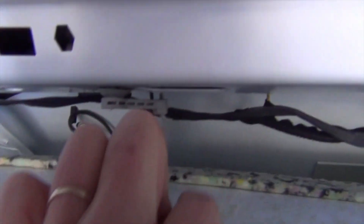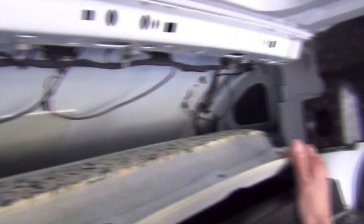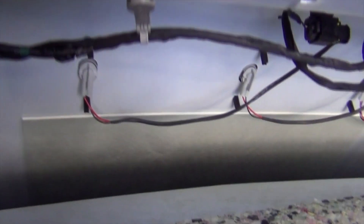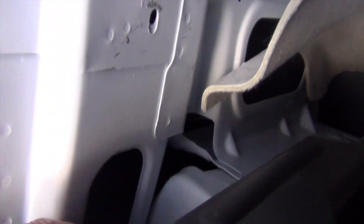There are a lot of spots in here where we can do a lot of insulation. Under here you can see there's space where we'll be able to put a bat of wool insulation. There seems to be a piece of sound deadening already there, which is nice, and a little bit of foam. We'll put some insulation in these nooks and crannies but we'll be careful right here because it says airbag, so I don't want anything going down in there — but this will make it cozier.